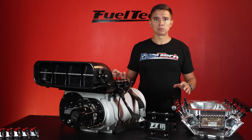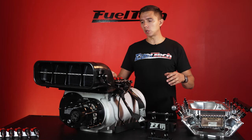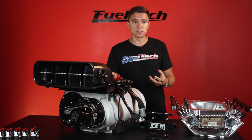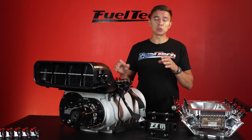Most of the time, lean outs act on both the manifold and the top of the blower simultaneously. You may have a small split between them using jets for a different bias. But it's going to be pretty much RPM and time-based. You can't change much down the track — whether it goes more to the manifold or more to the blower — without adding a lot of valves. And they usually don't respond based on boost. So mechanical injection is straightforward: the pump spins with the motor, jets restrict flow, lean outs create a controlled leak down, and you drop what you have.